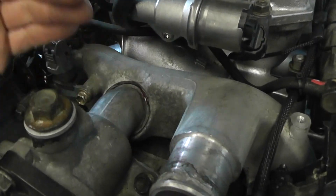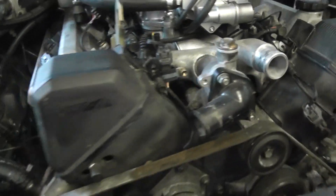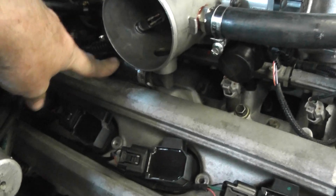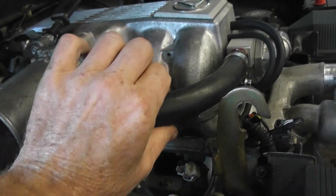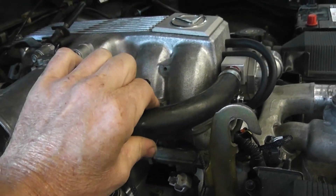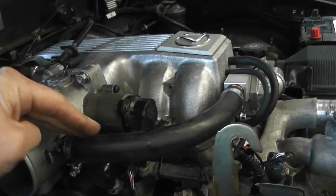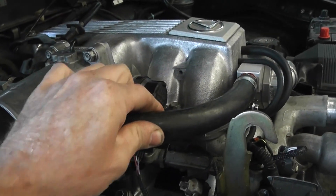Water hoses need to be water hoses, same as the top radiator hose. And we have another breather tucked over here. I've sold all my genuine ones and can't get any more at a reasonable price, so I'm using a vacuum multi-purpose hose — fuel and oil and vapor resistant. And I use the same for my hose running from the throttle body to the idle speed control, whether it's a standard one or aftermarket. Won't suck in.